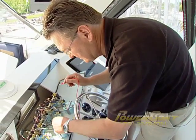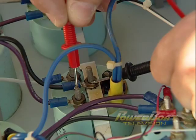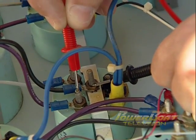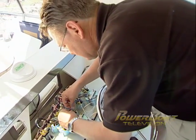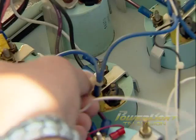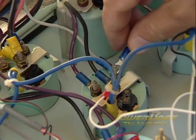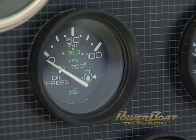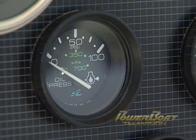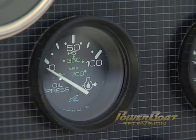Testing your remaining gauges like this oil pressure gauge is similar. First, start by checking for 12 or more volts between the power and ground terminals. To test gauge operation and the sending units, first turn off the ignition and connect a jumper wire between the S or signal terminal and the G or ground terminal. When the ignition is powered on and the gauges register a full deflection under these conditions, it's good. If the needle only partially deflects, the gauge is faulty.